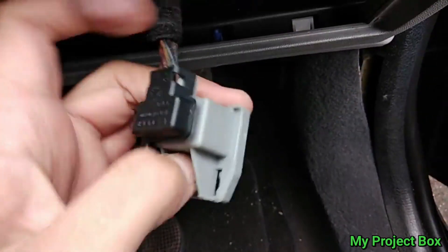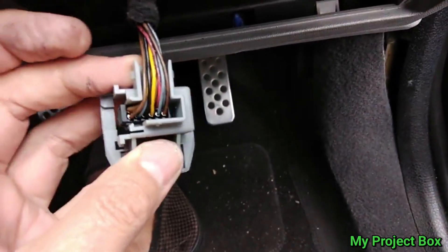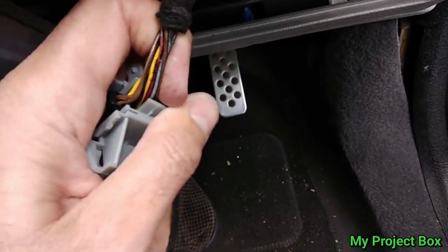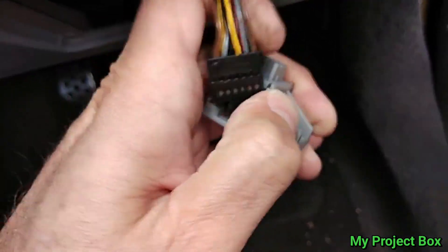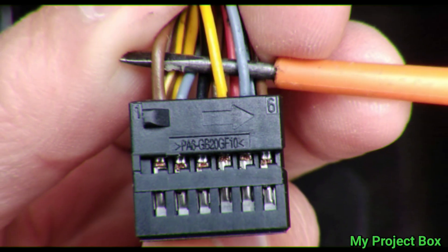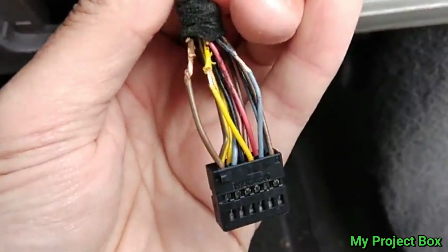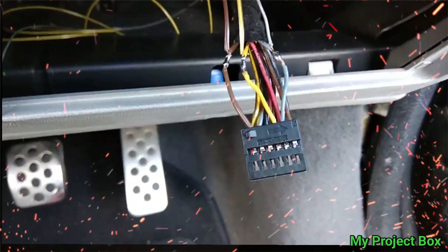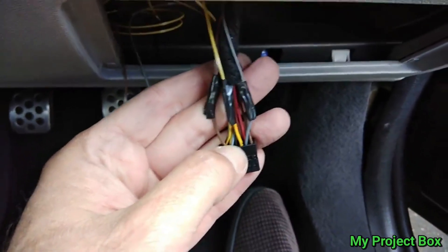At the back of the connector there's a black cover which you can unclip with a screwdriver and it just pops off. Then with a small screwdriver you can force the connector to slide out quite easily. We need wire numbers 1, 4, and 5 — number 1 is ground, 4 and 5 are the light wires, and if they're linked to number 1 the ground, the lights come on. We need to remove the insulation from these wires so we can solder onto them, then give them a generous wrap of insulation to protect them and tightly wrap the loom back together.